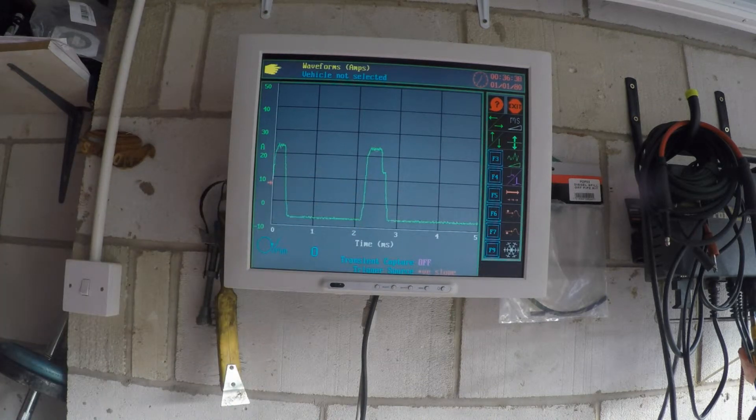So that's with one wire connected. I'll shift the time base here and I'd like to see the frequency this thing fires at. You're getting off the one injector two pulses, a couple of pulses, just shot at 160 milliseconds.